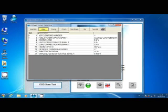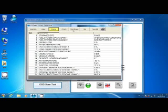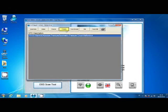Well, then we have three tabs: freeze, errors, and test results. They are related because they are all part of the error management of the Petrol ECU. So let's go to see before the other one, the error tab. In the error tab you find the errors that have been stored in the ECU and that have turned on the check light. Now in this demonstration we have disconnected a sensor, the MAP sensor of the Petrol ECU. So you can see here the error P0105, manifold absolute pressure, barometric pressure circuit malfunction. And we have the check engine light on.